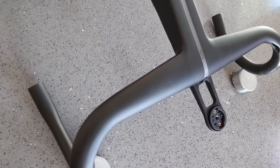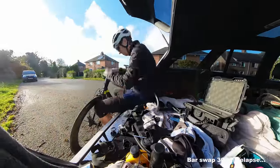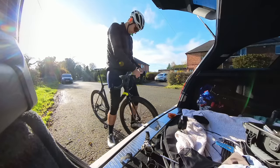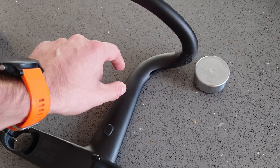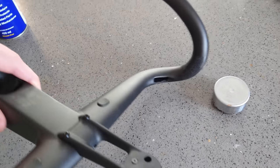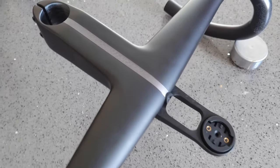You don't have to run integrated routing — obviously there's integrated routing through the whole thing, but I'm not going to use that because I'm doing a quick test on the rim brake bike first. It'll be a lot easier to set up out of the back of the car and do back-to-back tests. The finish and engineering on this are as good as any other carbon bar I've seen. The max bending moment on the bar is here and here, but I imagine the highest stress point is here because it's necked and thin, and you've got torsion from the drops. There's a bit of a stress concentrator there — and that's where they put the hole for cable routing. I assume they've done the stress analysis properly, but in total it's just a really well made thing.